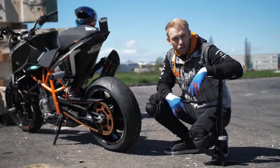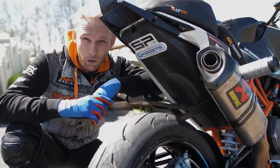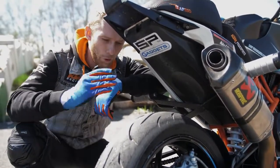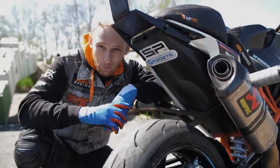The more pressure you add, the more stable your drifts will be. The next setup advice is the suspension — make your suspension harder. That gives you a better feel for the grip on the rear tire and eliminates that wobbly feeling while drifting.